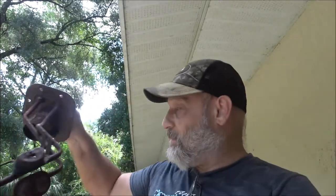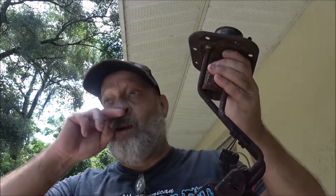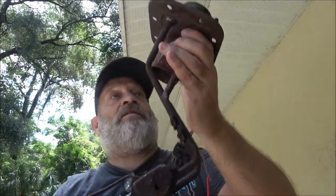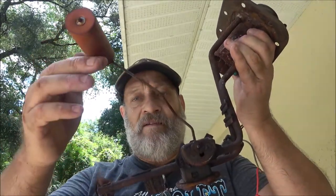So I'll tell you why we're replacing it here in just a minute. We're replacing this because this wire here for the sending unit has rotted off. This could all be cleaned up fine. This is your sending unit — as this goes up it puts more juice into the fuel gauge, as it goes down it gets less. As you put fuel in, this raises up, and when you get to a full tank it goes clear up there. That's what makes your gas gauge register.